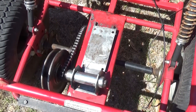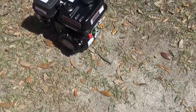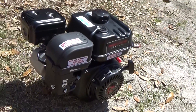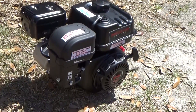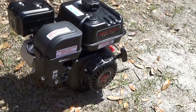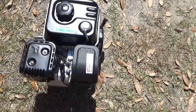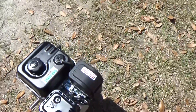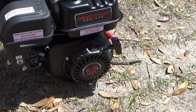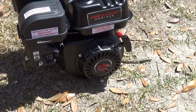What I'm going to do today is replace this with the Harbor Freight 6.5 horsepower Predator engine that you see here. Apparently a lot of people are getting this engine because it fits so easily and requires so little work to replace, which is absolutely the truth. This engine is only about $120, which blows my mind. I picked it up from Harbor Freight locally - they had 63 in stock. It's got some protections the old one didn't have, such as overheating protection as well as low oil protection - things that would have come in handy.